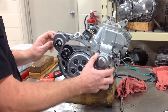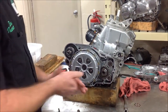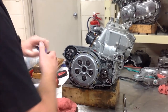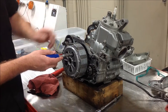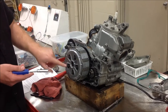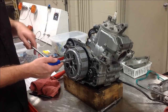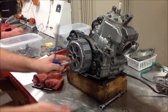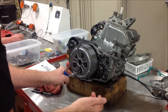This cover is probably not something that requires a specific pattern, but as a mechanic we should have the understanding that we may need to question that. So on these five bolts, if I go ahead and just turn this — do you see how it wants to keep rotating? These apparently are not torqued. This is a 6x1 fastener, so it's only like six to eight foot-pounds. I'm going to go ahead and un-kiss all of these, and I'm going to do this in a star pattern.